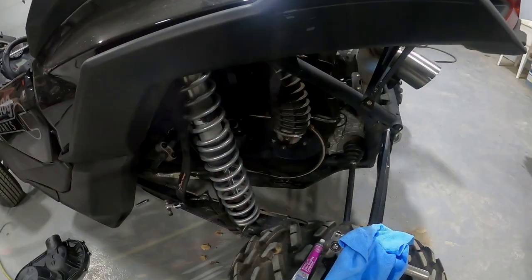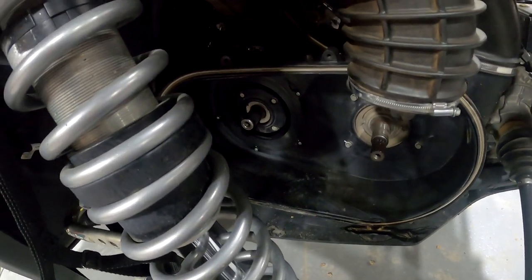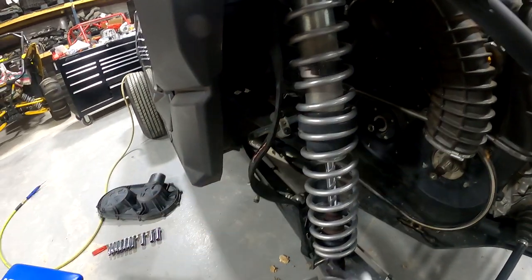Bread — 100% best way to pull the clutch off. It's clean, not going to spin the primary on the taper, it's cheap, not really that messy. So I'm going to get this cleaned up and then work on putting the new one on. What we need to do is mate the new primary clutch to the taper on the crankshaft. To do that, we're going to take some valve lapping compound, put some on the taper on the crankshaft and inside the clutch, set the clutch onto the taper, and spin it around 25 times by hand — placing some inboard pressure on the clutch while turning it. That allows those surfaces to mate up perfectly. If you don't do that, it can spin on the taper, and you don't want that.